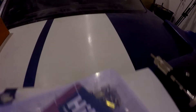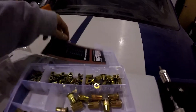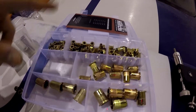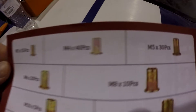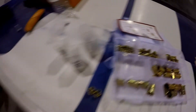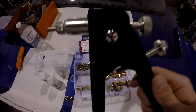So I got this — I don't know how to pronounce it. This is the rivsert kit. I just got this off Amazon — I forget the price but I'll put it in the annotation. Essentially it comes with all these different kinds of rivserts, gives you a little bit of everything. What we ended up using — it's got this little guide for you too — all metric stuff. So what I ended up using was these M6s. They gave us 20 pieces, we used like four on the hood and the rest were on the body kit. These are super sick.